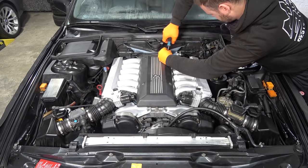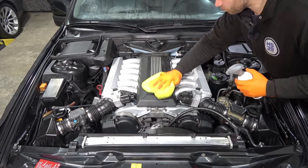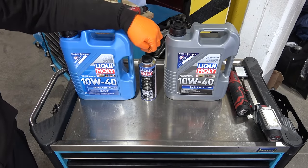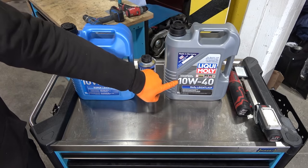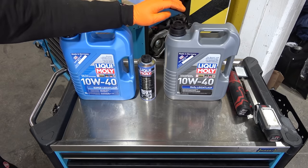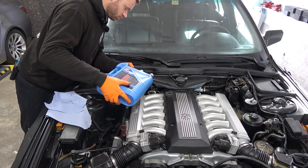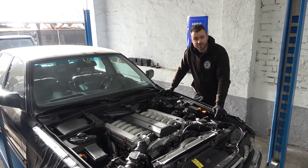The cover goes back on. Give it a bit of shine. Now we just need to add oil and we are ready to start. First we're going to feed it 10W40 synthetic, then do an engine flush — we saw that the engine was a little sludgy. And finally half-synthetic 10W40 with MOS2 additive. You have to remember that these engines were developed to run on mineral oil and actually prefer it over full synthetic, so this is a really good oil to run in that engine.